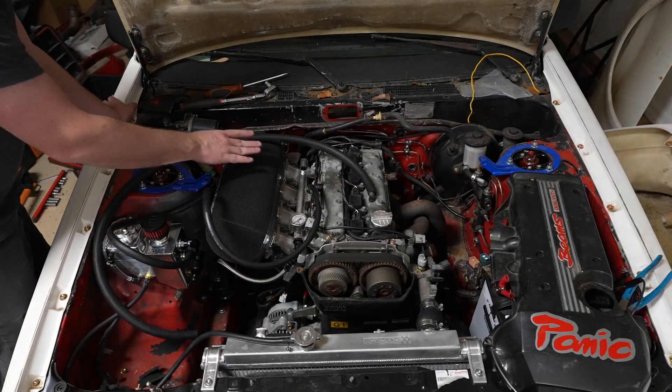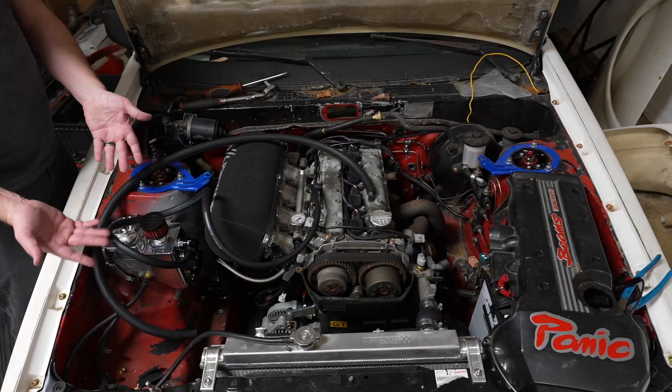If you're wondering about hose sizes and fittings: the 2JZ PCV valve with the 90-degree angle — I think Battle Garage sells them — has a 3/8-inch fitting, so it's 3/8-inch from the PCV valve to the catch can. The fresh air vent I thought was 5/8-inch, but that's a little too big, and half-inch is a little too small — so I'd err on the side of caution and go half-inch, or be prepared to use 5/8-inch with a hose clamp to make it seal better. My hoses are actually a 5/8 and a 3/8. Let's go ahead and route our hoses and get everything tidied up.